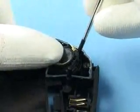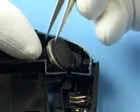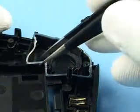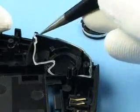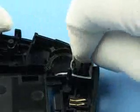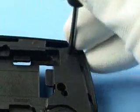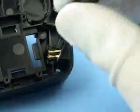Lever out HF speaker carefully. Remove old silicone gasket if it is already loose somewhere. Remove microphone by pushing a Torx driver through this hole. Corrugated tweezers should be used when removing DC connector jack.